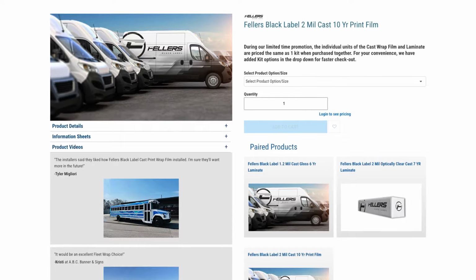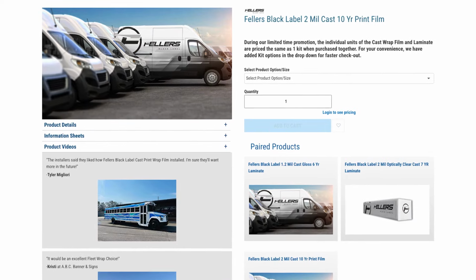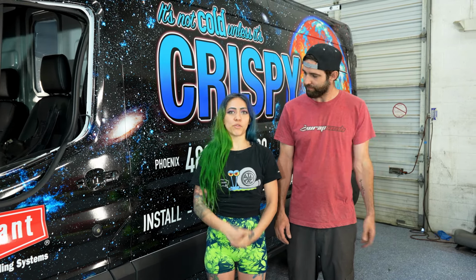I didn't know that. So we actually tried out the new cast series because most of the time, anytime we do vehicle wraps, it's going to be cast film. We always pick the easier, longer lasting film. That's kind of our spiel. We actually went through 4 different Sprinter vans, both for Crispy Air and Benjamin Franklin Plumbing, so we could get a really good feel for how this film lays and figure out the nice little tips and tricks to help you guys out on a successful install.